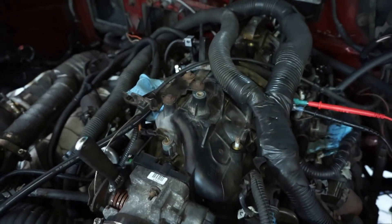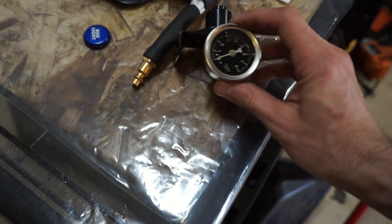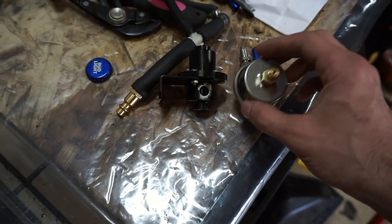I also wanted to let you guys know I did figure out the fuel pressure issue — it was actually the regulator on the return side, the aftermarket China boost reference regulator. This thing was like 16 bucks and I don't think it works very well. I made the assumption that it was accurate and it wasn't — I never tested it at the rail. I thought it was the rail regulator making it read really high, but when I pulled that out it went down to like 45 psi. It was reading between 80 and 130 with that regulator in there. That completely explains why the hose popped off inside the tank and why I had to pull like 20 gallons of fuel out at the track, because it was 130 psi — way too much.